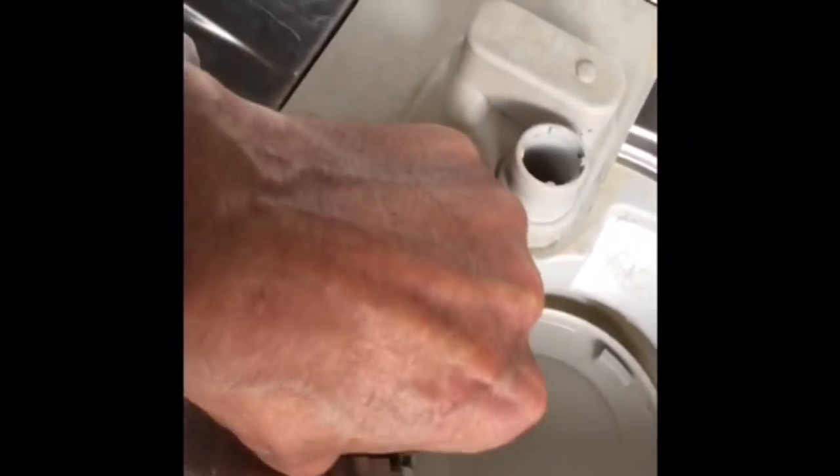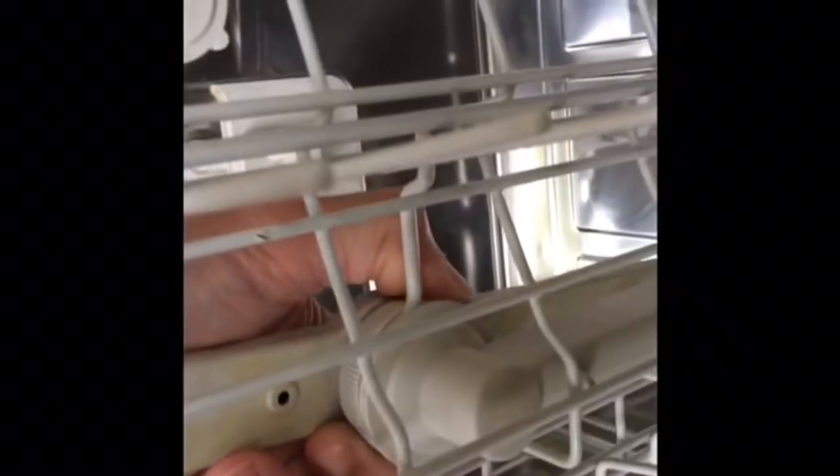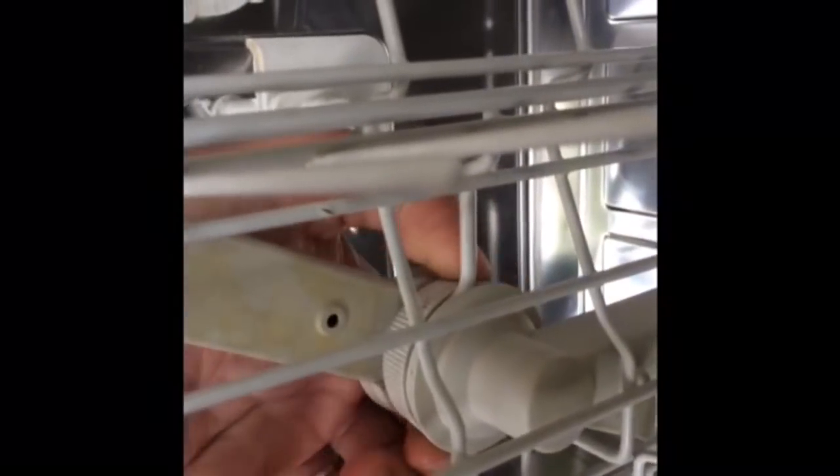We can lift out the one-way valve and also take out the little housing that connects to it — just kind of lift it out. You can take a look in there to see how the impeller is doing, make sure there's nothing caught down inside the impeller well. We'll also take off the upper spray arm by removing this little nut, turning it counterclockwise — in this case toward our right.